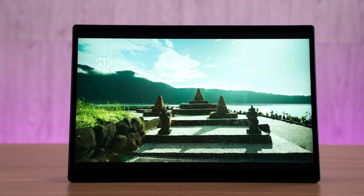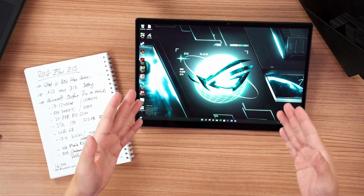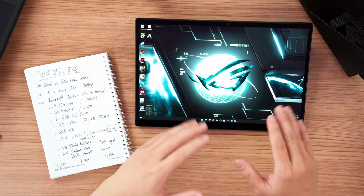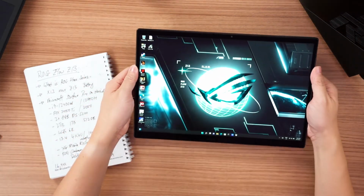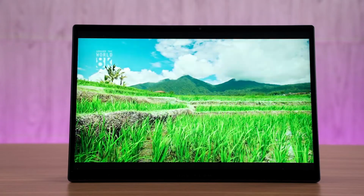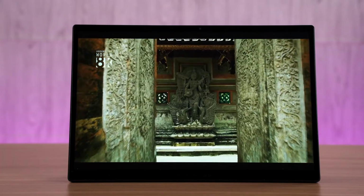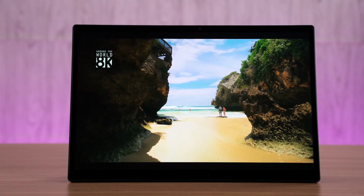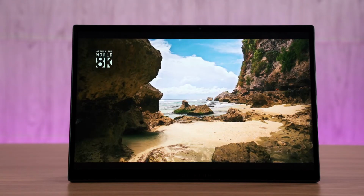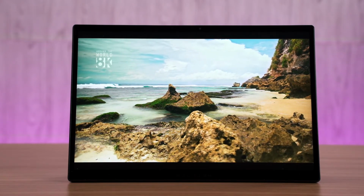This is a gaming device with an RTX 3050 Ti or 3050. Imagine you try to push your games in 4K resolution. I don't understand why 4K is a thing for a tablet. I know 4K looks great, sharp, vivid, if you downscale everything to 1080p, you have 4 pixels binned into 1 pixel and all those sharp details. Yes, it looks great, but for a gaming device, what really matters is high refresh rate. Even if you give me 120Hz, it's fine. Especially on a device with a 13.4 inch screen size, 1080p doesn't really matter.